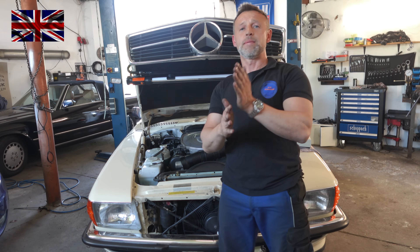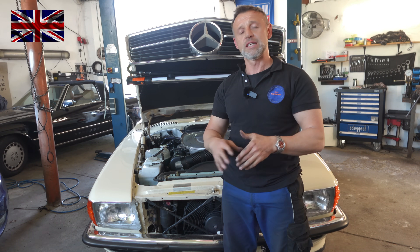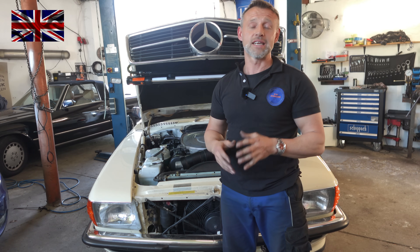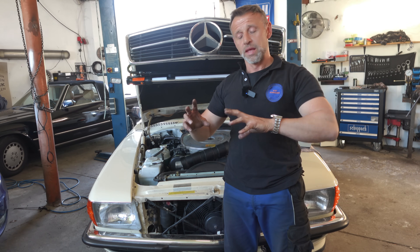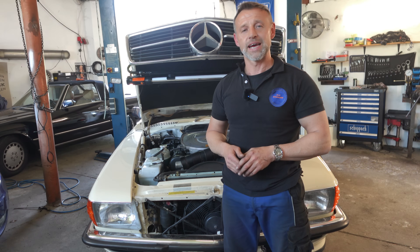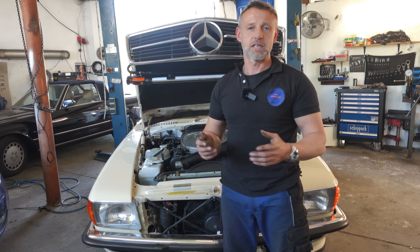A simple fuse caused all that hassle. But having checked all the sensors and given them a wipe — they're functioning well, both front and rear axle. The blown fuse did not give me high revs, so I did not look there from the beginning. Never mind — my fault, I've learned the lesson the hard way. Thank you for watching, hope to see you around next time. Bye bye everyone.